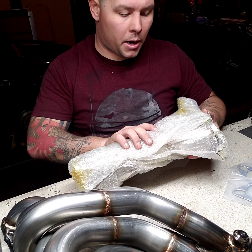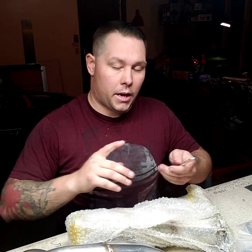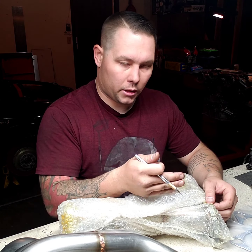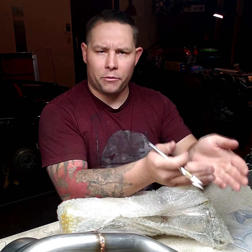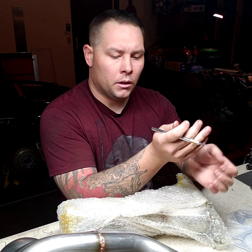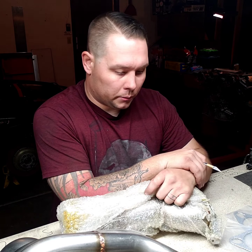I got my secondary piping. One of the other reasons I bought this was because the long tube manifolds — especially with my experience in the IS300, GS, and SC — the SC is the easiest to install because it's got room. But in my IS300 I had the hardest time getting the manifold to sit correctly towards the bottom to bolt to the stock OEM catback exhaust. The issue was it didn't line up, partly because they were two different companies, and partly because that manifold was like a hundred bucks. This is not a hundred bucks — this is expensive.